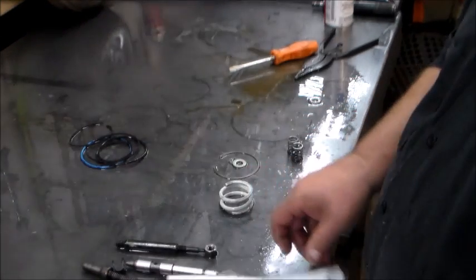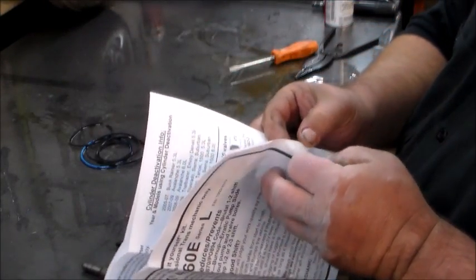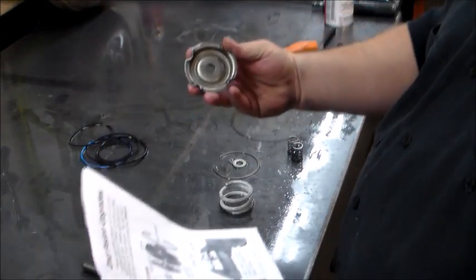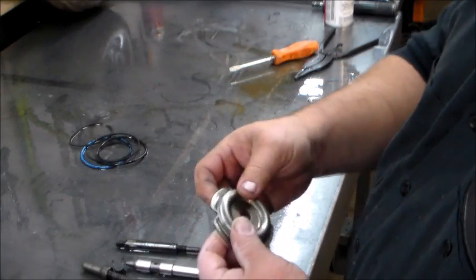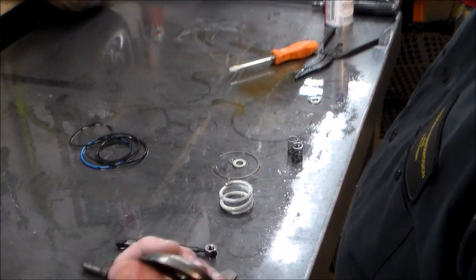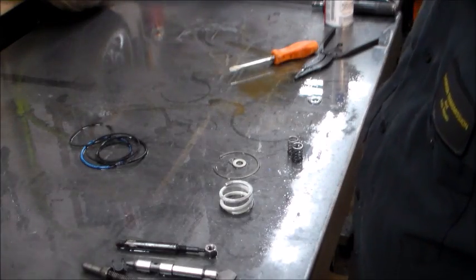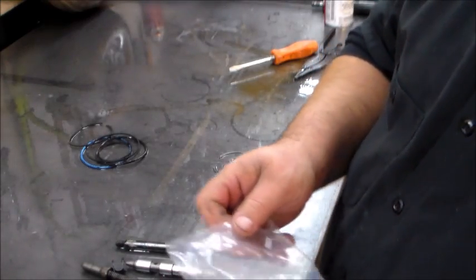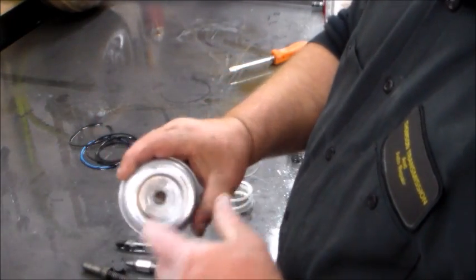Remember we talked, this is the shift kit. There's a couple modifications you have to make to the servo. Biggest modification is you have to grind 4 notches. They just let fluid exhaust from these holes. Kind of turns the 2-3 shift off a lot quicker because this thing doesn't hold hydraulic residual pressure and hold the band in place. That's kind of the purpose. This is a 553, it's a pickup truck.